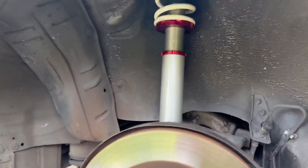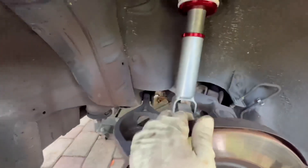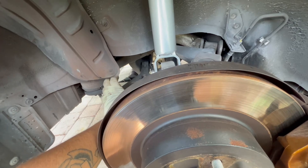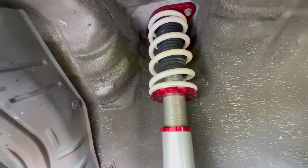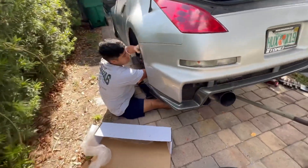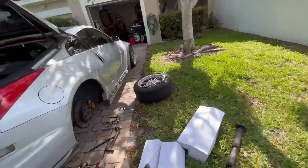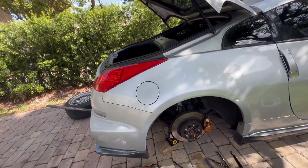My side is done — I still have to drop it to see how much to adjust. Everything bolts right up. The rear is pretty easy: all you have to take off is a 17mm bolt and nut, remove your spring — don't leave the spring in there or the car won't get any lower — then two 12mm bolts on top and that's it. What I messed up on was not bringing jack stands, because you do have to lift the spring bucket up so the coilover lines up, but we made it work.